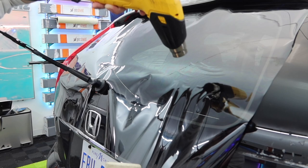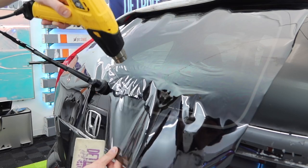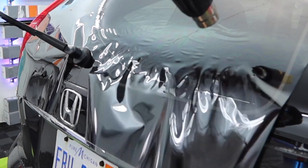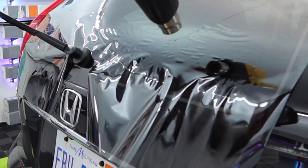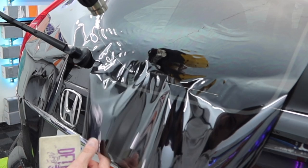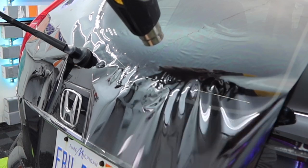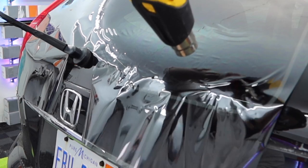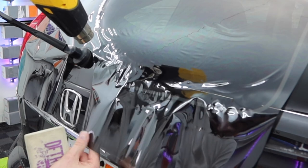You'll notice at the bottom I'm kind of tugging on the film — not pulling very hard, but just lifting it off the glass and putting a little heat wherever I'm tugging the film. This will allow the film to just pull flat, and I'm evenly distributing the heat. I haven't even had to use the felt card yet. When you hit the film just right with that heat, it just lays down perfectly — you're not seeing hardly any tension lines, and we're just working our way back and forth.